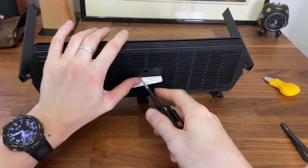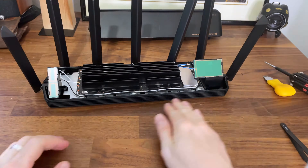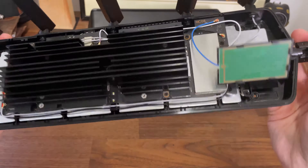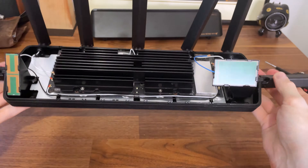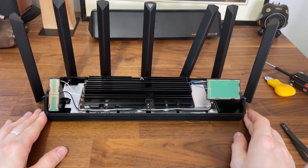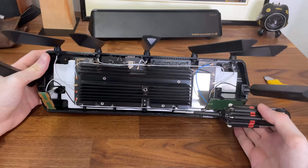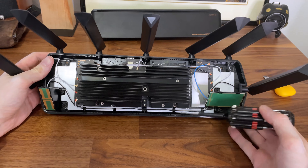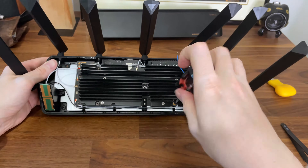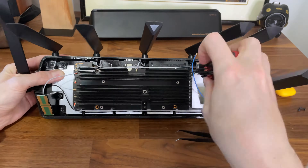After taking out the top plastic part, I was greeted by a very unique layout of components. We can see the PCB covering most of the space and what looks like two huge antennas, each with its own dedicated plastic support. The one on the right appears to be for NFC, as it's written on the case, and Xiaomi mentions it on their website as a way to pair the router to the app without passwords. At the top of the PCB there is a fairly large heat sink, and I also caught a glimpse of a metallic heat spreader from the bottom of the board. There are many holes in the plastic, so it seems the manufacturer took heat management seriously.